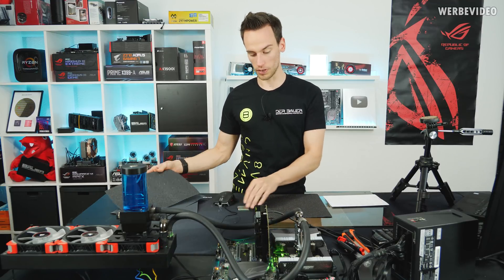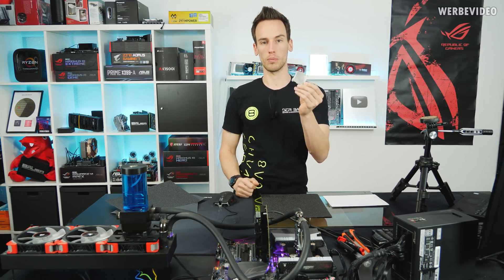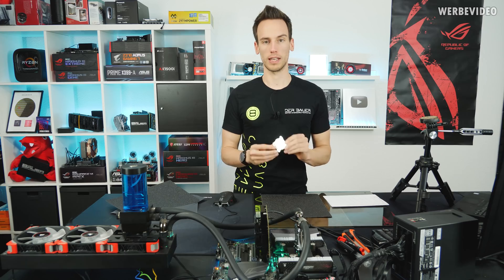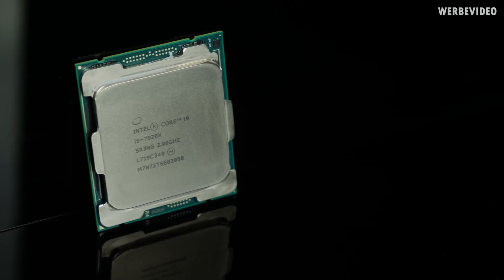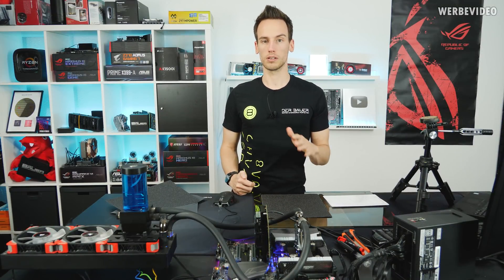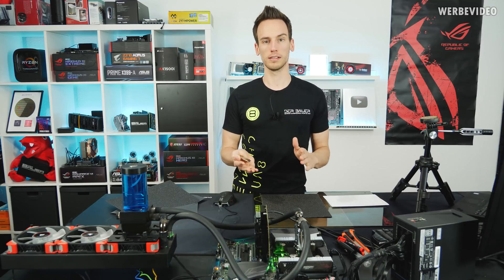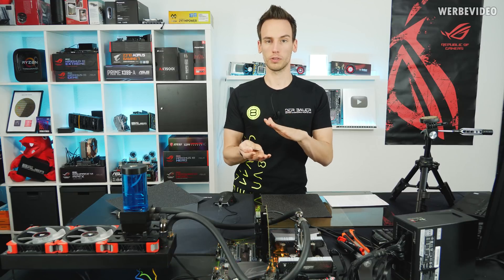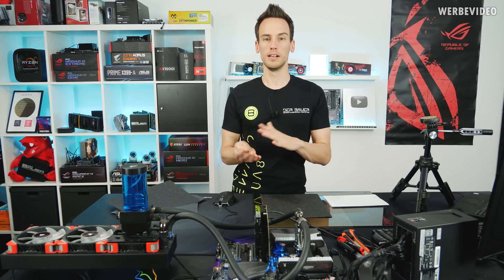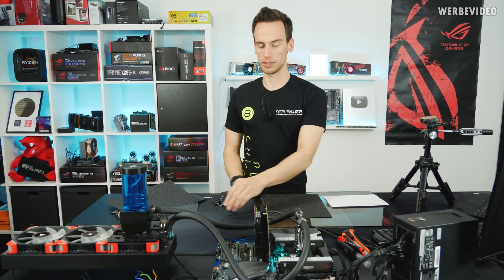We will start with a very, very rough surface, essentially removing the top layer — the nickel layer covering the copper IHS — removing every unevenness, and then see what temperature benefits we get. We will use a 7920X which is currently mounted in this system. The CPU is non-delidded, complete stock, so we will have more accurate results. From my experience, if it's a delidded CPU with liquid metal and you perform sanding afterwards, you will always move the IHS a little bit and it will have a negative influence on testing results. That's why I decided to go for a non-delidded CPU for this test.